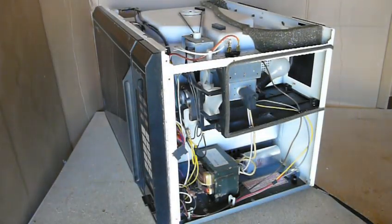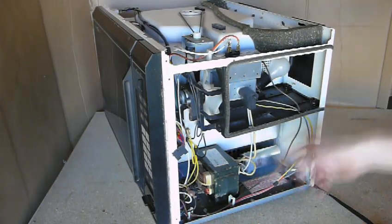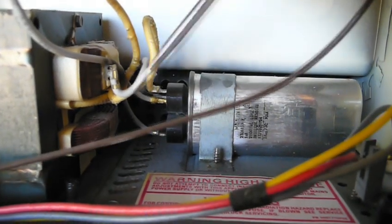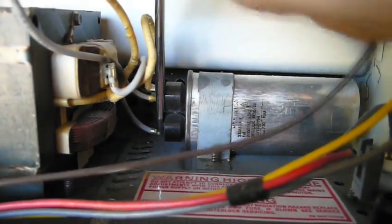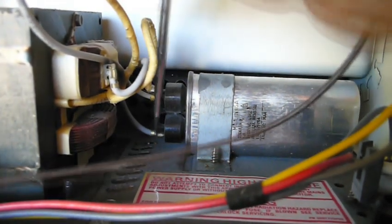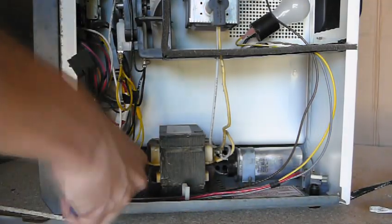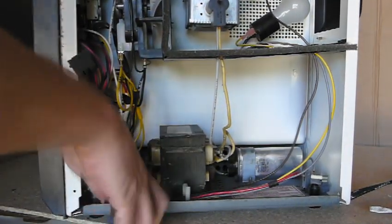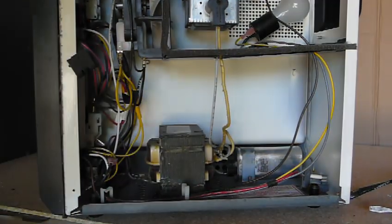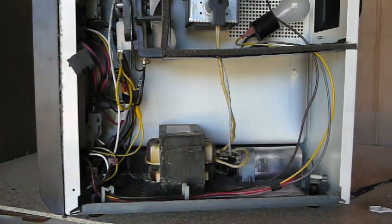Here's a look inside. There's the transformer — that's what we're after. You can also see the capacitor, the magnetron, and a bunch of other stuff. It should be discharged already after a few minutes, but you want to take a screwdriver and make sure you short the terminals on the capacitor, otherwise you get a 2,000 volt shock. Make sure you short them a lot. Now that everything's safe to touch, you can disconnect the transformer. There'll be four or five wires — you can use pliers to disconnect them, or just cut the wires leaving a couple of inches.